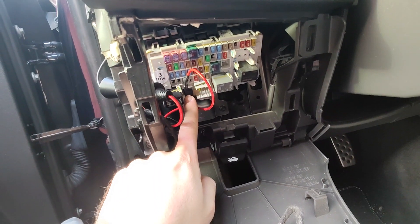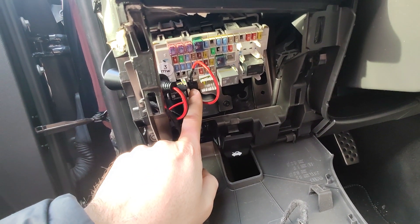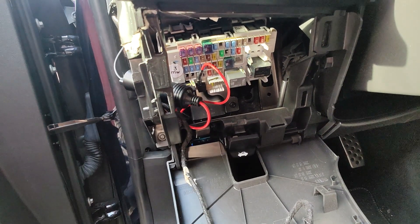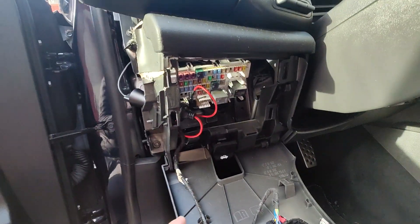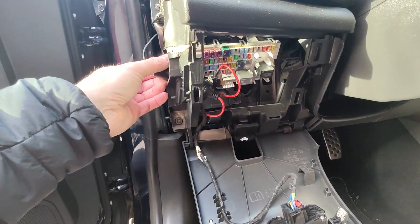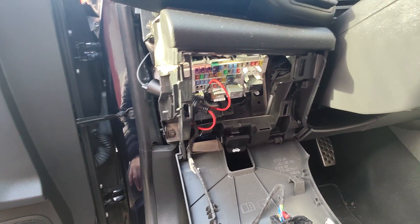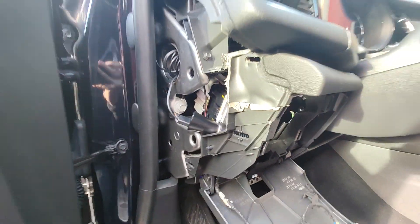The plus is on fuse number 36, which is for the visor charger, with this side plus power outlet. When I switch the ignition on, the power outlet comes on along with the visor charger, and it works as it should. I hope this helps someone — see ya!